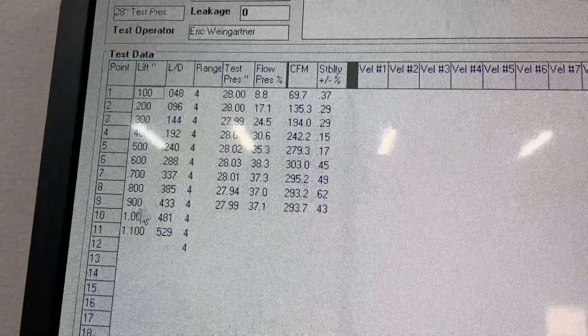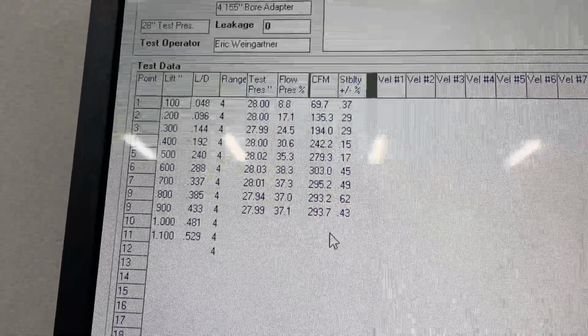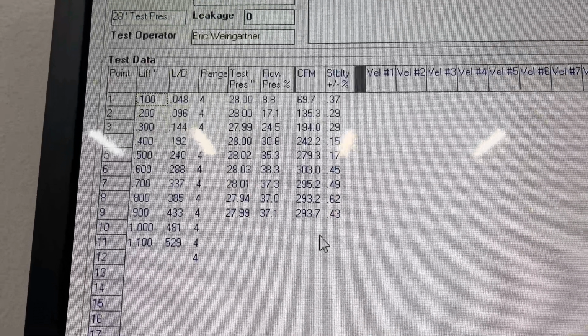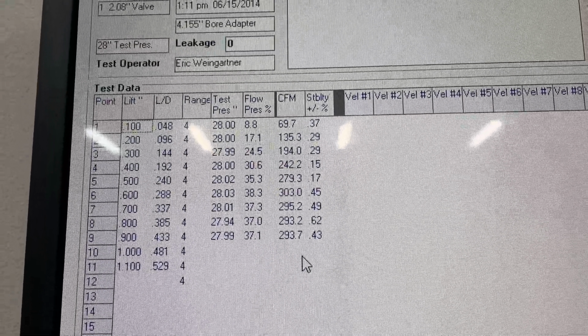Now, if you notice, I've stopped the flow test at 900 lift. Usually I go to 1 inch and everybody's like, well, there's no need for 1 inch. If you watch one of my other videos, I talk about that, but I won't go into it now. The reason why I couldn't flow it at 1 inch is because the retainer would hit the seal. So it bottomed out, in other words. So this is as far as I could go, 900 valve lift, which doesn't matter anyway.